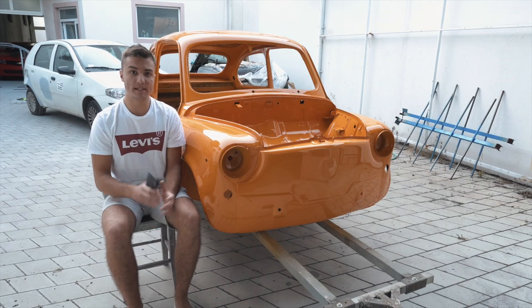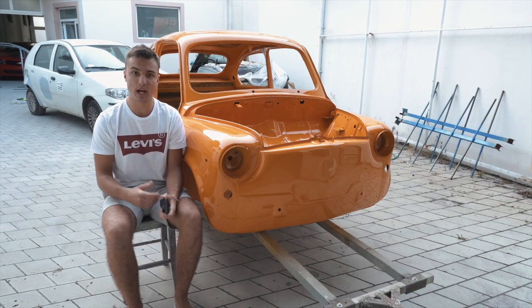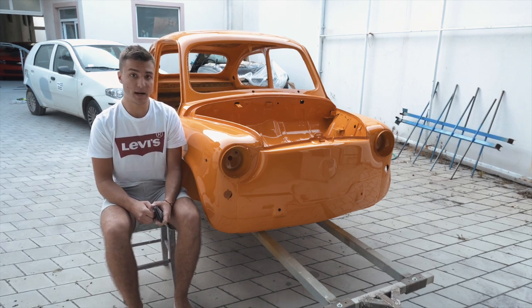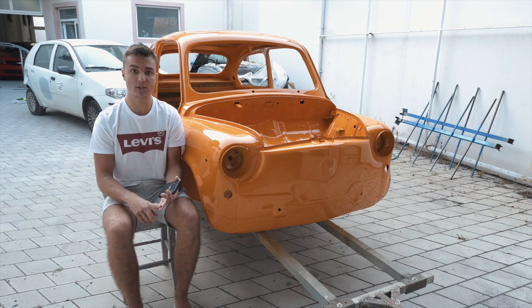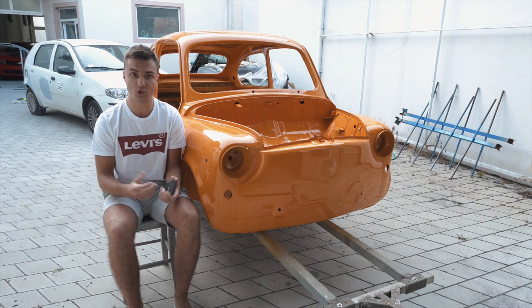And there you have it, people, from the start to the finish. Now, I didn't go in depth on how to clean door jams, windows, and dress the tires because I hope most people already know how to do that. But the two main things I hope you guys have taken from this video: number one is the foaming, and number two would be the drying with the air blower instead of a microfiber towel or chamois.